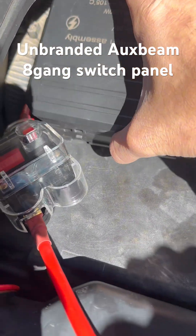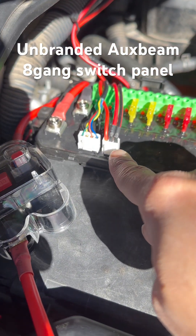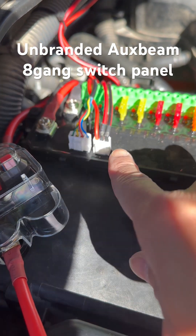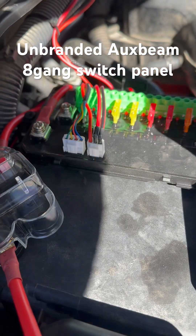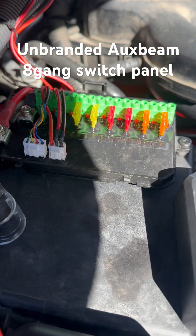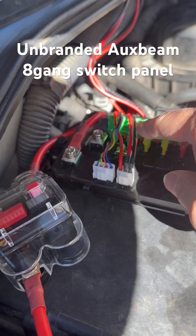This is how I did it. I had to create my own wires with a terminal on the end. I had to drill out the holes a little bit bigger just to fit the connector, but these pins can individually come out. I have two — the middle one is to tap into your on/off source which is the parking lights, and then this one is to adjust the brightness.